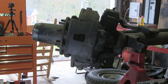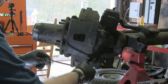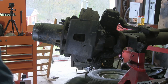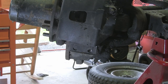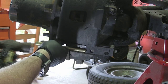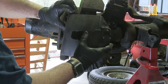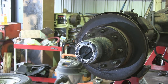Now that we've got our drag link out, we're going to go ahead and remove our caliper using a quarter-inch hex. We'll use a hammer and a punch to drift this key out — it sort of acts like a wedge to hold the caliper in. If you haven't disconnected your brake line and your caliper is still really tight, you may need to use a big screwdriver to push against that inner pad and push the piston back just a little bit so you can get it off.